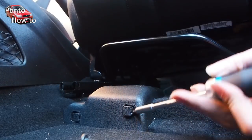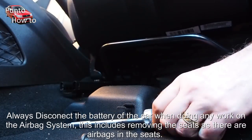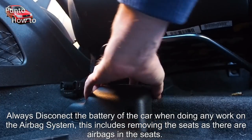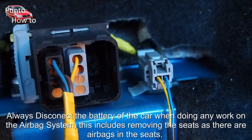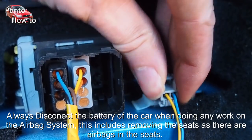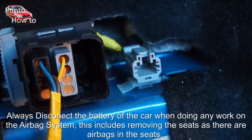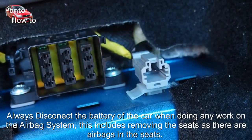You will also need to detach the wiring for each seat. At the front of each seat is a little plastic cover — with a small sharp screwdriver just ping these little pegs out, as they secure the cover over the wiring plugs. They just pull out once you've popped them and the cover simply pulls off. Once you've removed the cover you can gain access to the wiring plugs. The one on the right you just pinch and then pull the plug out — this is for the sensor for the seat. The other connection has the wiring for the airbags and for the seat belt sensor: pull the little yellow tab, pull the grey tab sideways, and everything disconnects.